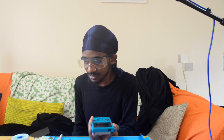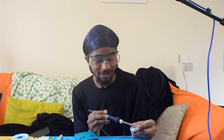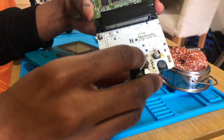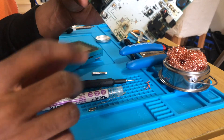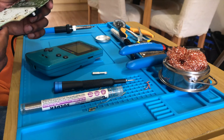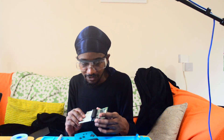At least now I have a Game Boy Color that works. I don't even know how I got this Game Boy Color, genuinely — at most I think it's something I got off eBay and forgot about. So if you haven't got sound on your Game Boy Color, you might want to check that capacitor first because it looks like that was a bit weird. To show you the capacitor on this now really empty Game Boy, it looks like it's this one here — so it's worth checking that out because maybe replacing that solved it. Either that, or maybe this little capacitor here which I broke off when I tried to repair this board before for a power issue. But yeah, that seems pretty good. I wonder if I should take some of the other bits and pieces off this for other things — this is a very lonely Game Boy board. Now I've gotten this sorted out, all I need to do is mod it.